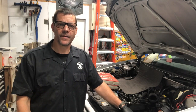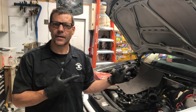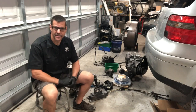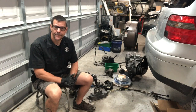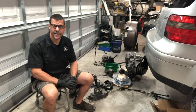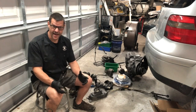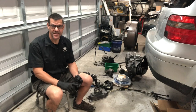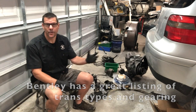Now let's look at all the parts you're going to need — there's a fair number. You've got to decide right off whether you're going to do a five-speed or a six-speed, which depends on the kind of car you have. For TDIs it's very tough to find a diesel-geared six-speed. The transmissions may physically bolt up to any of those engines, but they're geared differently for the 1.8, 2.0, and TDI, so it's important to match the gearing for the car to perform properly.